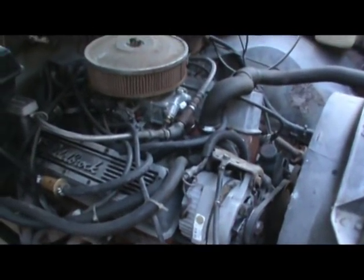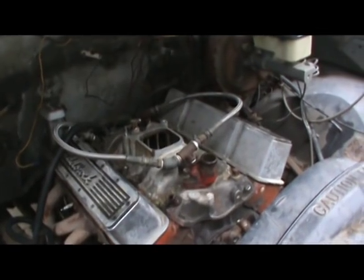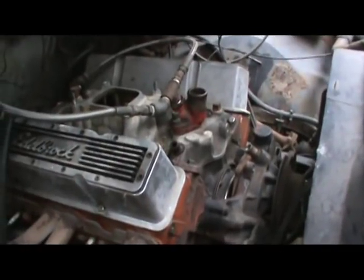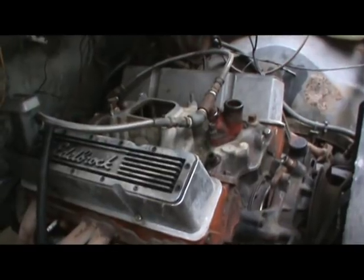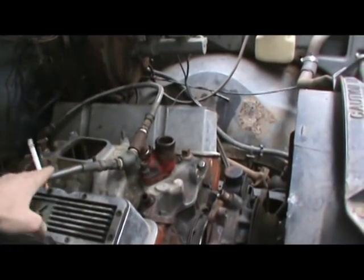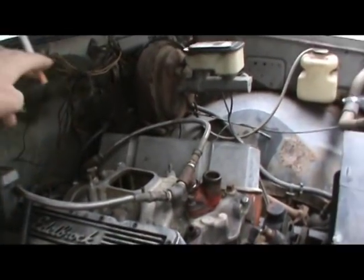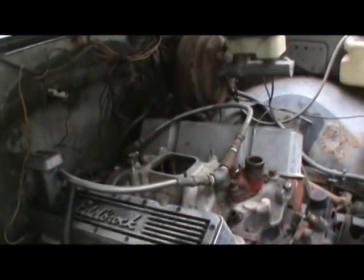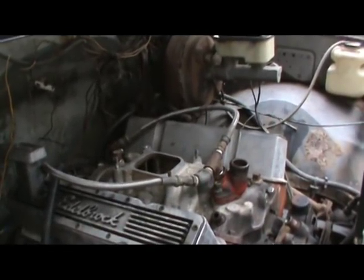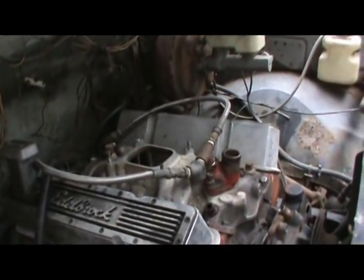That's our project, guys. I'll try to keep you updated. I didn't want to bore you with all of the taking the pieces off this motor. Got the alternator off and all the hoses and wiring pulled back, distributor out, carb off of it. This little situation here — that's something my dad did long time back. What he's trying to do is where the water in the back of the head comes around, he's trying to improve the circulation, thinking maybe it'd help keep the head gasket from blowing. I don't know if it helps or not, but that's his deal. I'm just putting the heads on for him, not trying to reinvent the wheel.